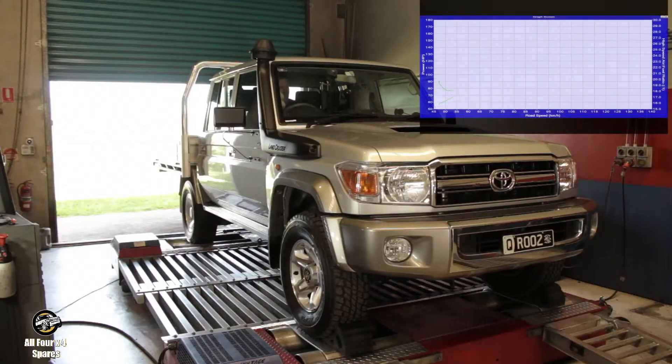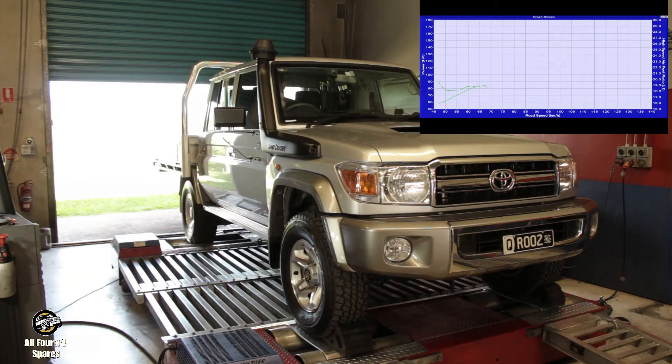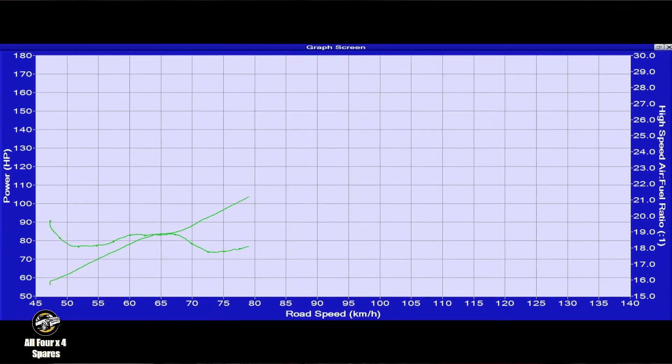Loading it up now. It's releasing — the brake is releasing — let it go through its whole rev range. I'm watching the graph until the power starts to dip off. We got to about 350 degrees on the exhaust temps. We'll get more into exhaust temperatures when we're out on the road testing with the trailer on the back. Okay, now it's time to hook up the van, take it out on the road and see what it does in the real world.